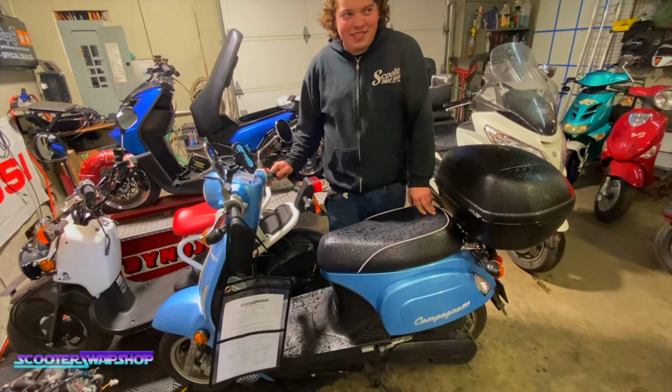So what do you got left on this thing? Throttle cable. I had to make a custom throttle cable. Custom one? Why is that? Well, the PWK, this guy down yonder, the D slide has the largest slide, so it doesn't have enough travel. It's not that the actual cable itself is too short, it's that the inner doesn't have enough travel. Yeah. Cable goes on, clutch cable, shifter, premix in, spark plug on, and away we go.